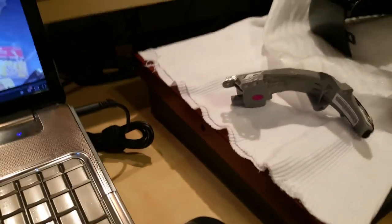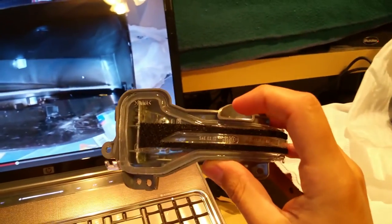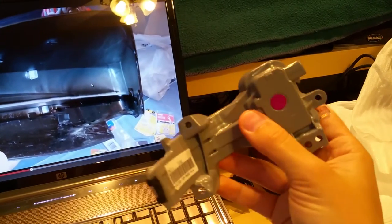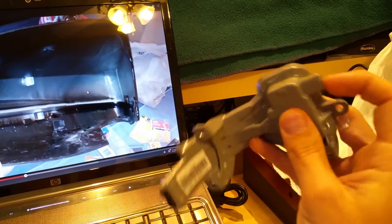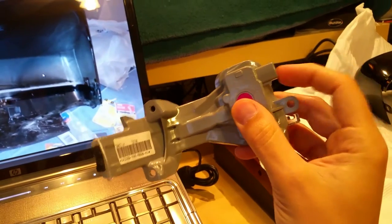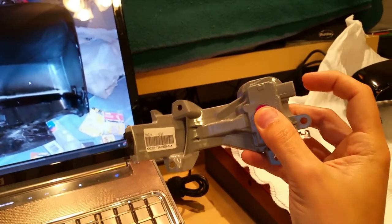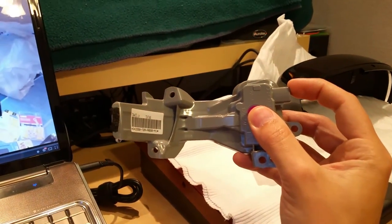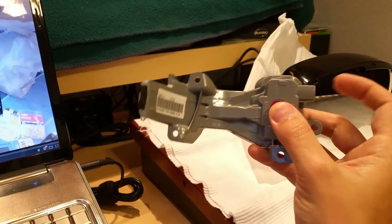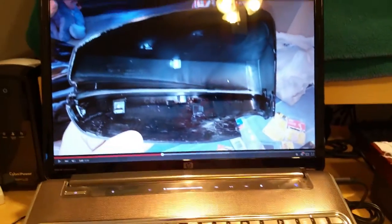As far as wiring it up, it is very, very simple. I've already added a ground and power wire inside the skull, as shown in my previous video series. To make the LEDs work properly, one side is polarized — I haven't put test leads on it yet to determine which is positive and which is negative. The negative goes to the black wire ground already run through the mirror. For the positive, use a very thin wire — about 18 gauge, maybe even 22 gauge if you can fit it through. I'll probably try 18 gauge because it gets pretty packed, especially on the lane watch side due to all the extra wires for the lane watch camera.